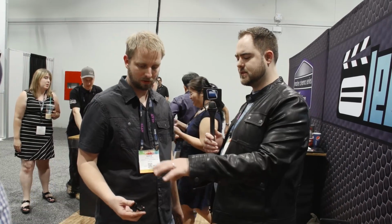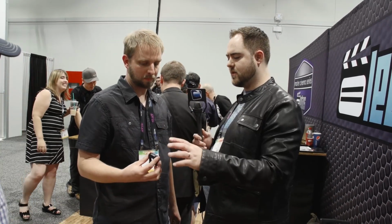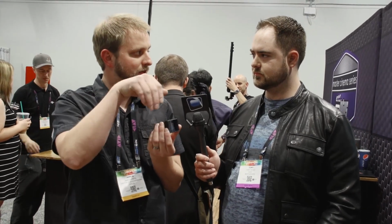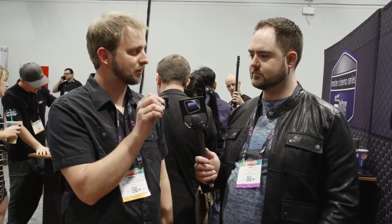How's the autofocus? Because sometimes the GoPros underwater are a little bit finicky. With this, it's fine because the front of this adapter is flat. You get the trouble when there's a bit of curvature to it, because water is technically a lens too, so you have these two lenses fighting. But with the flat front that this one has, it's no problem at all.